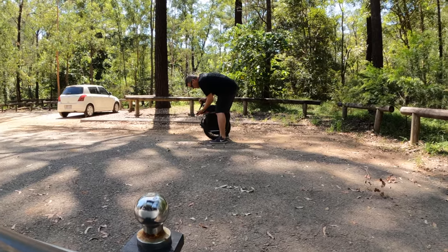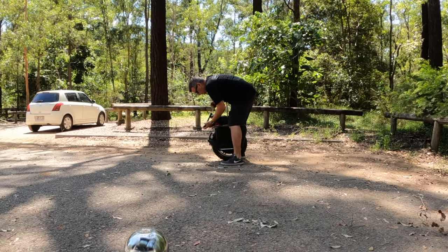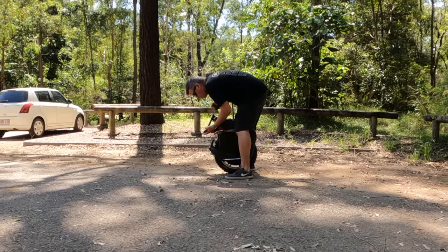Really quickly about the Begode Hero: it's an 1800 watt-hour battery, nice torquey motor, really nice knobbly tyre. It's got an airfield suspension which I'm running at around 170 PSI and it's got 80 millimeters of suspension travel. It comes standard with spiked pedals, a really nice mudguard which overlaps and stops mud and dirt from going up your back, and a really nice bright headlight that has the auto on and off feature.